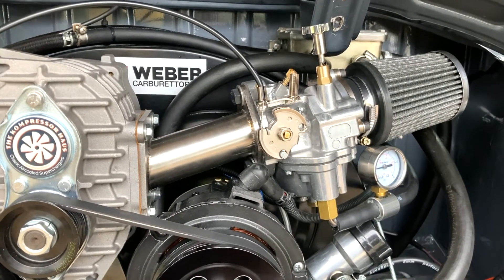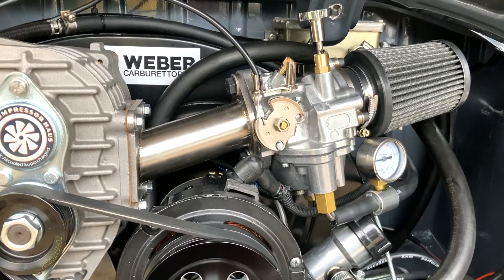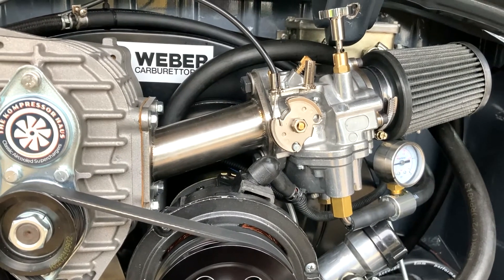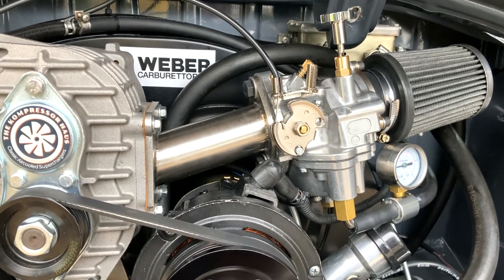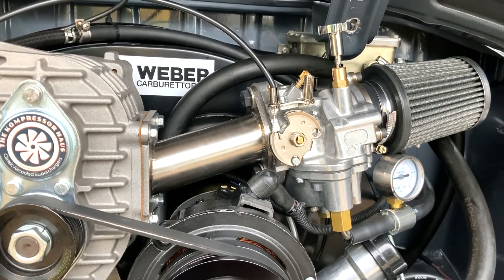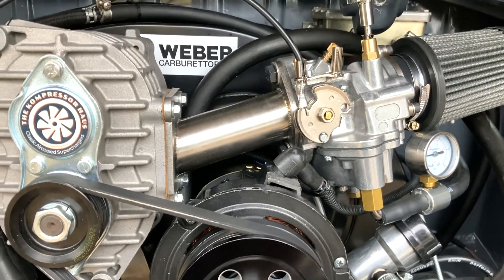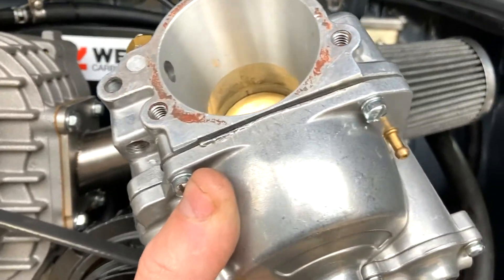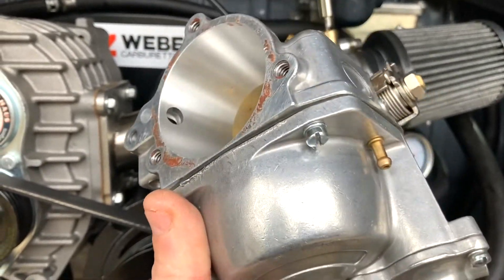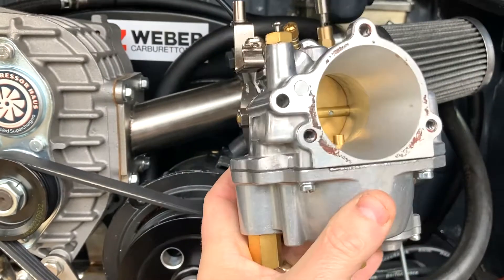There are a couple more reasons why you might see fuel coming from the overflow pipe. If you're in a hot country and your vehicle is outside - imagine a fuel can in the sunshine - when you open it up, it will release pressure because of heat. In hot countries, the heat can create pressure in your gas tank, which will push fuel out of the carburetor and out of the drain hose onto the floor. This is something they often see on Harley-Davidson motorcycles.